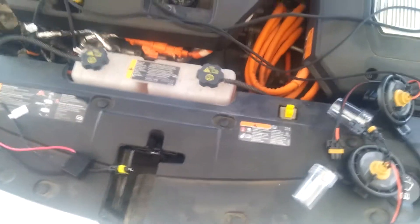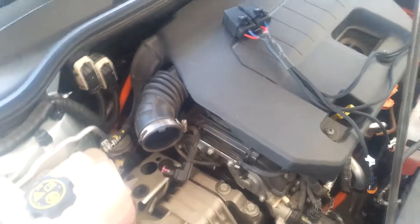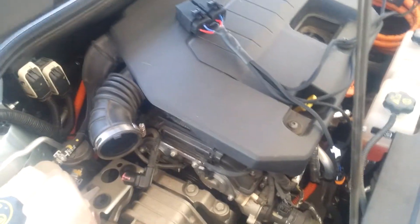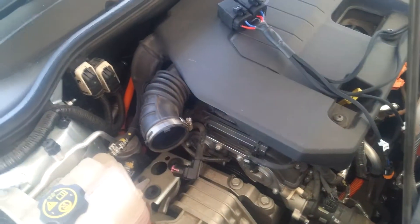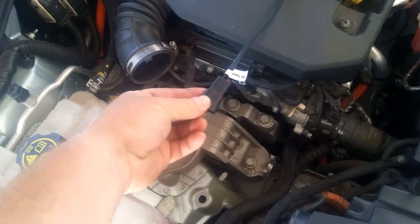I'm going to pause the video to do some more work. I've removed my air box just to get better access. Here's one of the light sockets — there's the factory wiring. From laying this out, it looks like I'm going to probably end up mounting my relays on this side of the engine bay. You only have to tap into the OEM lighting on one side — it doesn't matter which side. This is just your trigger to your relay, in conjunction with the capacitor.